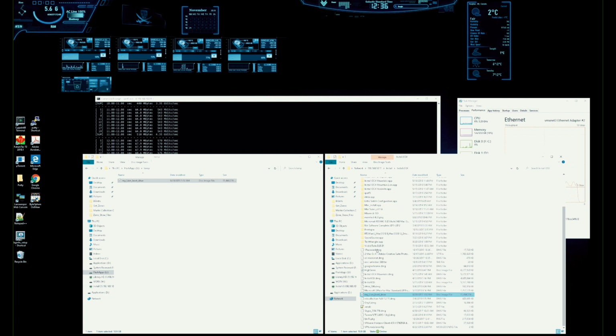which is okay, I guess, on that particular network. So that's your normal file speed. If you're using big files and moving things around, that's very helpful. I still don't recommend using that approach to edit your videos off that NAS unless you have SSD cache directly in that NAS, or you have M2 cache installed.